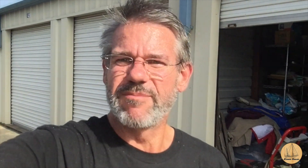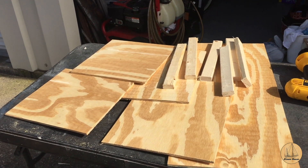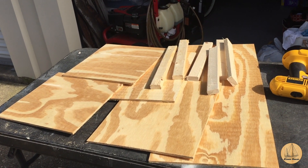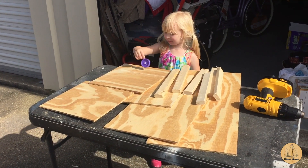If anyone's been watching our channel for a while, you know we're about to embark on a pretty large fiberglass project. We've been removing the teak decks of the boat and we're about to do another layer of fiberglass over the decks after we've repaired the places in the core that needed it. Before I do that job, I wanted to do something else as a test — I'll make a small deck box that's going to fit between the coach house and the butterfly hatch. It's a pretty simple box, about 27 inches long, about 14 inches wide, 11 inches in the center at its widest, and a foot tall. Just a small box to keep a few tools or supplies on deck. It's just quarter-inch plywood and one-by-two, and I'm going to wrap the edges so they have nice smooth transitions. Really this is nothing more than a quick and easy frame or mold that I can wrap fiberglass around — both inside and outside — to make it fully waterproof and strong.